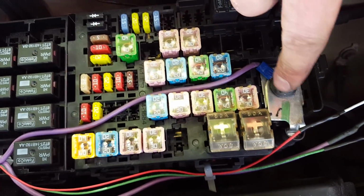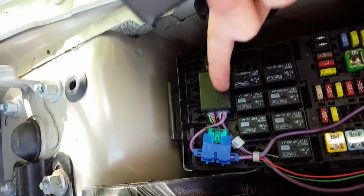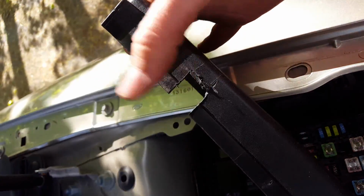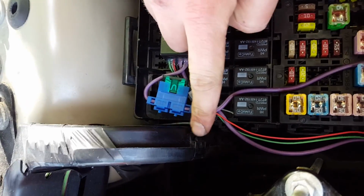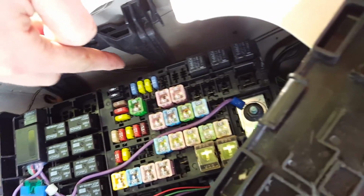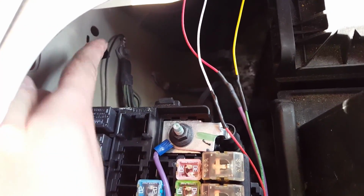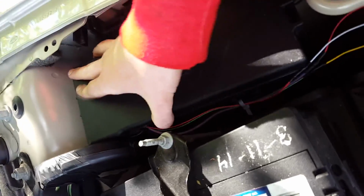And then it goes down here, it gets power from there, and then I modified the box here. You have to cut this away a little bit to have enough room for that, and then you also have to open it here to get the cables out. You can see this black cable here is ground, which goes around very clean under there, and then to the original ground connectors, which are right there. Okay, so you have plus and ground, so power and ground, and then I put this back together later real clean.